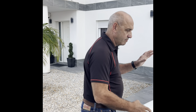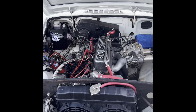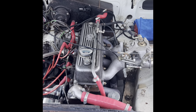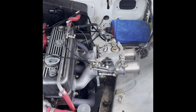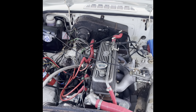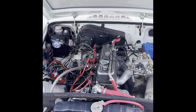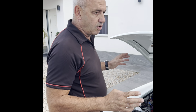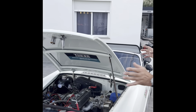The next thing that comes up is: 'I've got a race car or a track car with a big Weber carb and it doesn't really produce vacuum.' Nonsense — absolute nonsense. I just want to quickly show you our staff car: fast road cam, stage 2 head, twin choke Weber, sports exhaust — on top of all the suspension lowering and the rest of it. The vacuum advance has transformed the way this car ticks over.